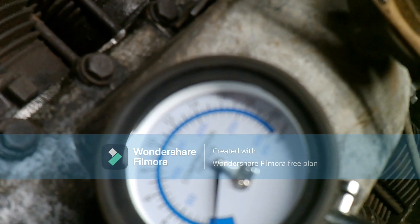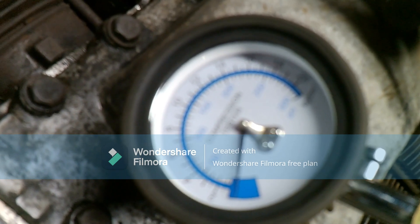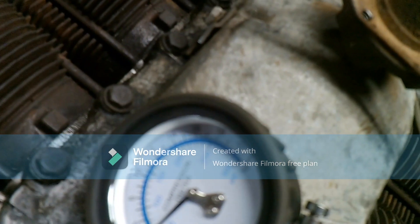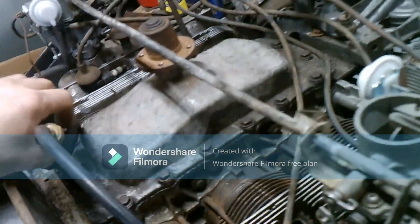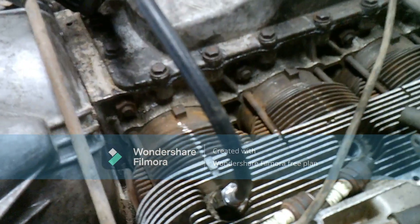All right, last one, number six. That one again — oh no, that was about 60 PSI. One thing never spoken well of these engines is that they were a high compression engine. I think stock this thing had eight and a half to one compression. Compression test done — results: poor.